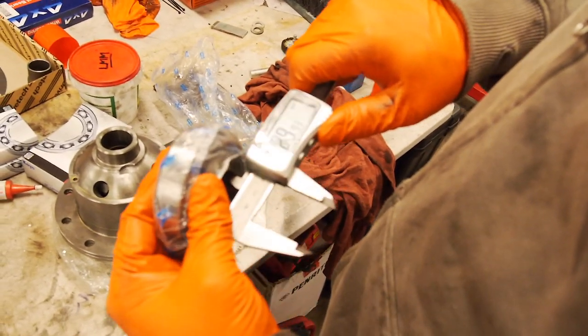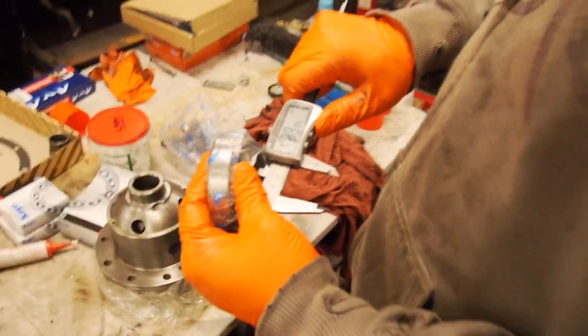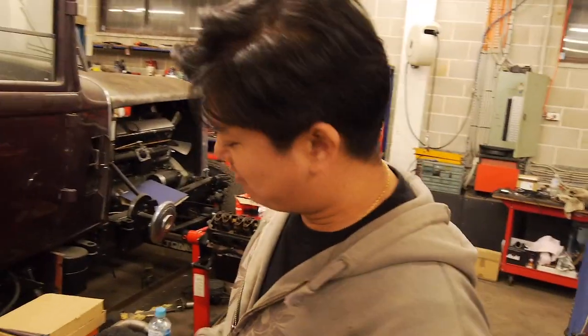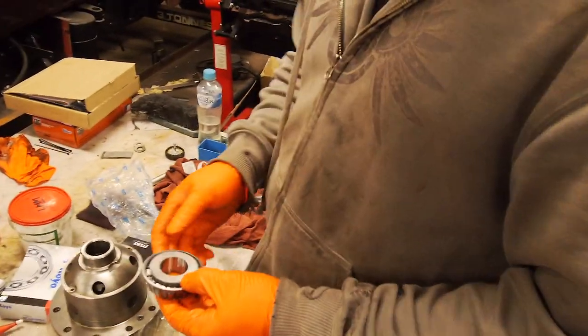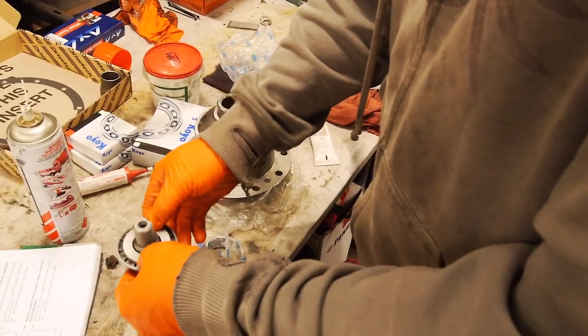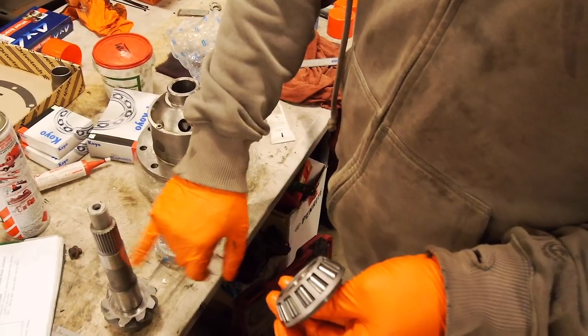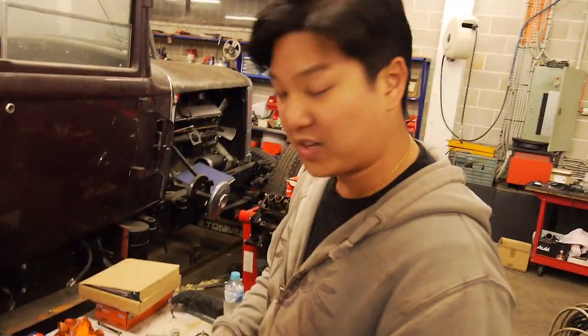There you are, it's 8 microns under. Well, six microns under. So how do you know all this? Somebody's got to. But, yeah, well that's within the measuring accuracy of that unit, so you can just put it up. So what that means is, if we put a bit of mounting paste here and here, that's going to help us when we're trying to set that in float, in terms of getting it to move.